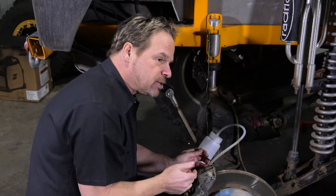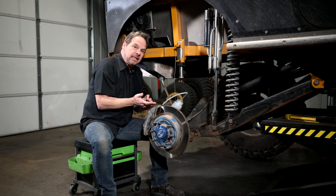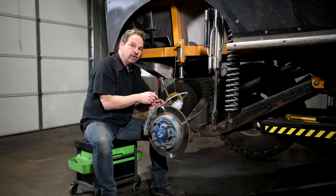When you're going to flush your brake system, connect everything the same way, crack the bleeder, and watch the fluid until you see a distinct change in the color of the brake fluid, then tighten it up and work your way around the vehicle.